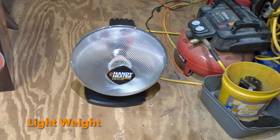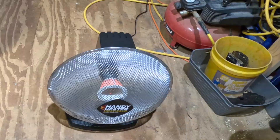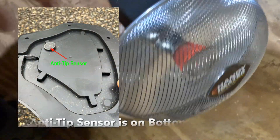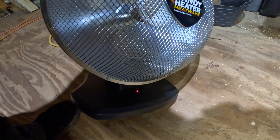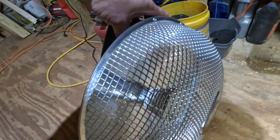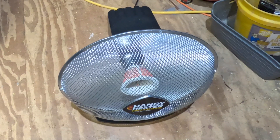It is very, very light, and it does have a tip sensor alarm. If you move it backwards, forwards, or to the side, the alarm starts going off. The red light is supposed to start flashing but it stays solid, and then it turns off. You can see it's turned off since it's been tipped — and now it's starting to heat back up.